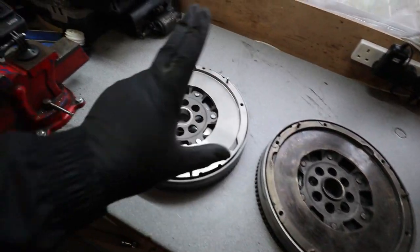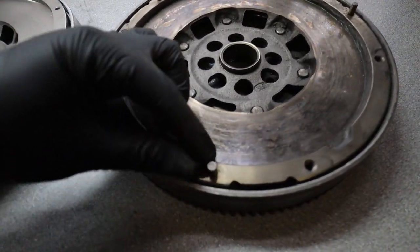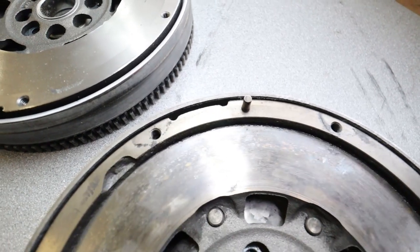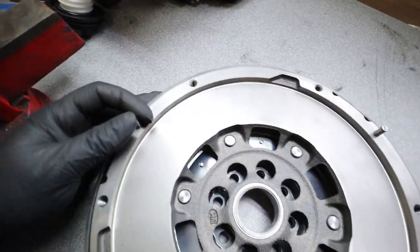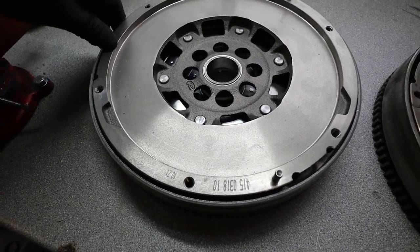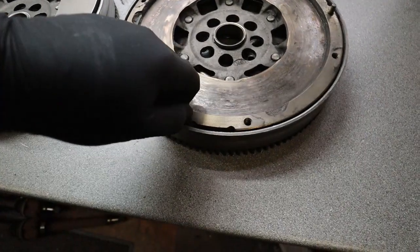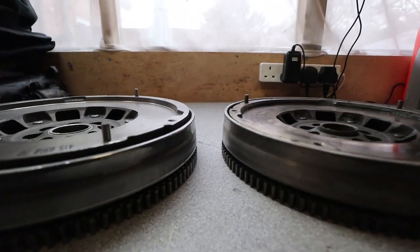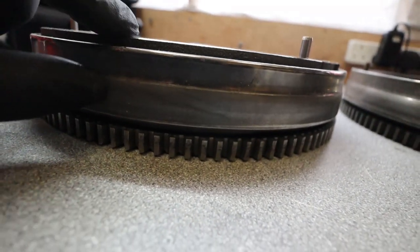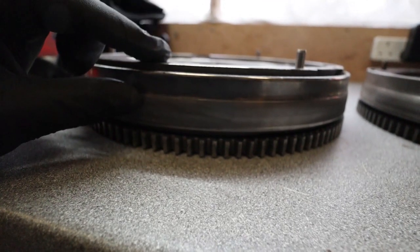There's a bit of oil that spilled out because that goes straight through into the engine. I'm going to let that seep out for a minute, clean it up, then put the new seal in. The rear main seal is now in — I've made sure it's at the same depth it was before, just a little bit below the surface, and completely square all the way around so it doesn't bind up.